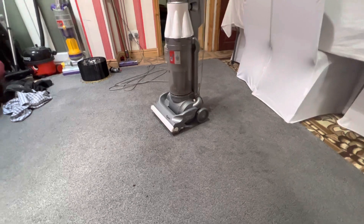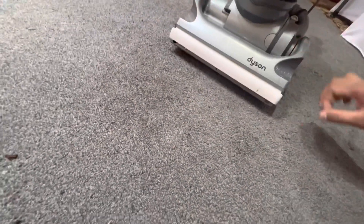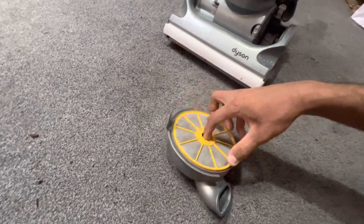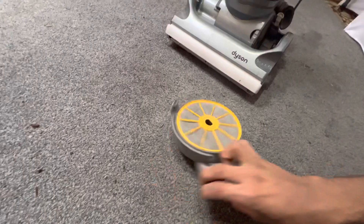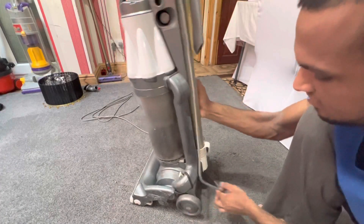As you can see, it's cleaned up the majority of the dirt but not properly — still left bits behind. That's probably why there's a loss of suction. Let's check the filter. That's looking quite mucky already without even checking it fully, so let me get this out. Yeah, that needs washing as well.